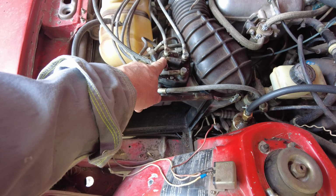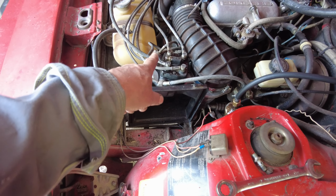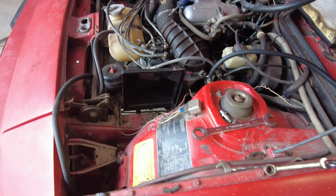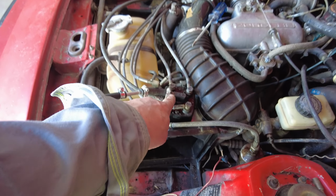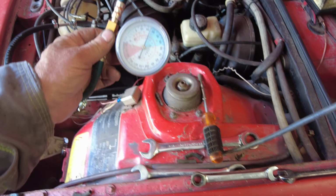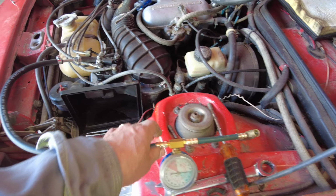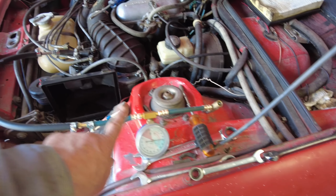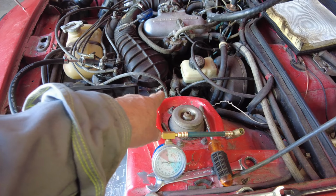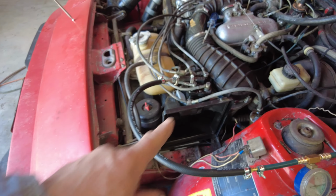That's for sure. Now the next test, if I can get something hooked up to figure out how to, onto here, and then I can get fuel flow through that pump thing there, see what happens. Okay, now I did, this thing here is another leaky connection, but it sort of tells me a story. It's holding 20 pounds of pressure there, or 25, just in there. And when I turn the motor over, it goes up to 65 or 70, which is the same pressure, equal pressure as there. So fuel's going through the plunger business, right?